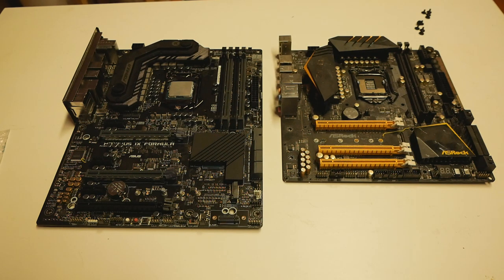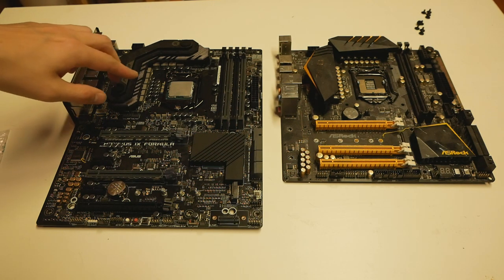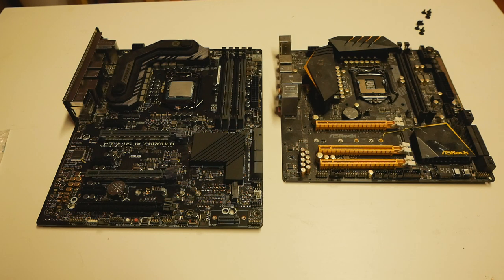The things you have to do in order to run the CPU in the old motherboards are still the same. You have to modify the BIOS so that it supports these newer CPUs, like get the microcodes in, have all the required fixes so that you don't miss hyperthreading. Of course, hyperthreading is not included in the more affordable 9700K Coffee Lake model, but that doesn't really matter. And make sure you can still overclock the CPU when you run it in the old motherboard.